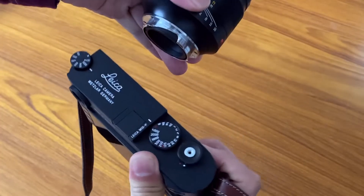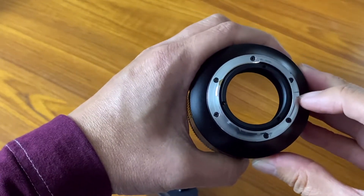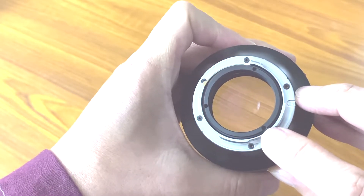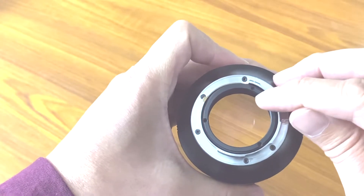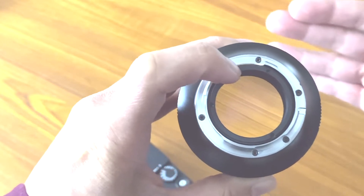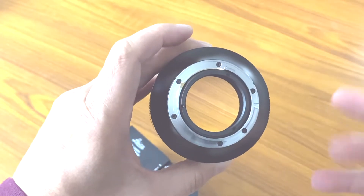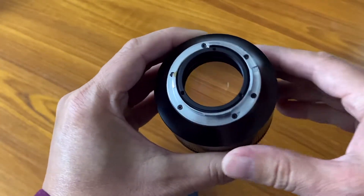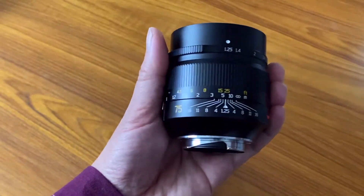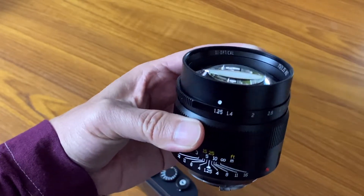Let me take the lens off my Leica and show you how the adjustments are made. This is the rear element. You put the little U-notch to the right, and there are two small screw holes — you can't see any screw head, it's more like a hollow screw hole — and you use the special tool to loosen both. Then you move this ring counterclockwise if your focus is a bit too far back, or clockwise if it's front-focusing, in millimeter increments. Then tighten it down and retest two or three times until the focus is accurate. Out of the box it's actually pretty close, at least with my camera.